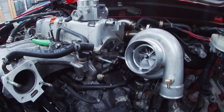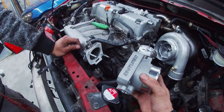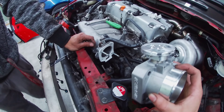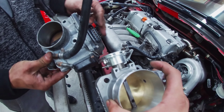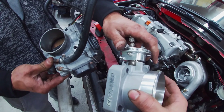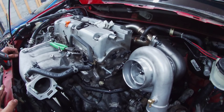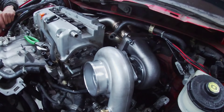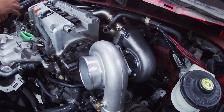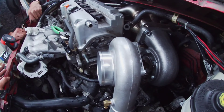We're gonna order that today so it should be here in a few days. The other issue is the throttle body — these throttle bodies feed on it but these ones run with cables, while the other one runs with wires, so we got the wrong one. We can still reuse this one or I'll just keep it for mine, and he's gonna order the correct one. I put the turbo and manifold together to see what we're dealing with space-wise, because this is an '08 Si and they're really hard to work on with all the factory stuff.